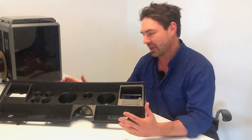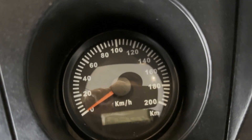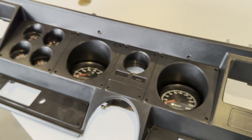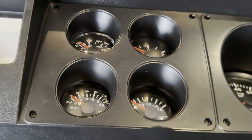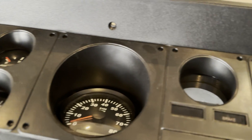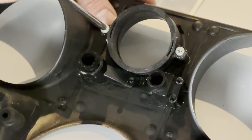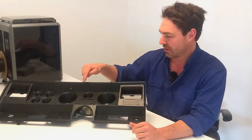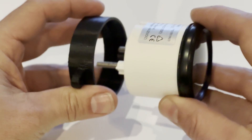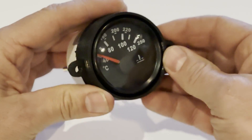I'm really happy with the result. The fit and finish — on the larger gauges the size is 92 mil and the actual holes are about 100 mil. The holes for the smaller gauges are about 40 mil in the fascia and the gauges are 52 mil. Getting that alignment was quite a challenge, and the gauges come with a little slot on each mounting point so you can get side-to-side and up-and-down adjustment. For the clock, I've made a little bracket that screws directly onto the fascia and replaces the old HZ clock. It's a big gauge and does the same thing — screws directly to the fascia. I just don't have an upgraded gauge for that yet, but it's exactly the same size — 52 mil.